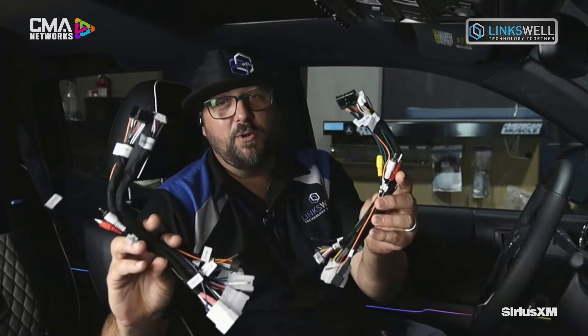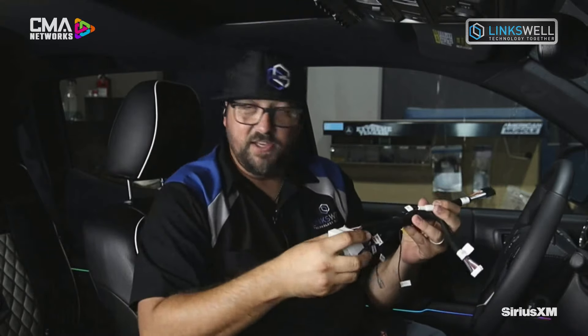I'm not going to bore you with how to disassemble the dash — I'm assuming you've put in a couple of radios. What makes us different is our harnessing and the fact that we are all plug and play. I'm in our Tacoma right now, so I'll walk you through what you'll find in pretty much every T-style radio. We've got two power harnesses because Toyota loves to do a mid-product shift, so regardless of whether you've got the newer or older Tacoma harness, factory-matched female plugs go right into our radio plug.